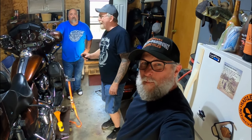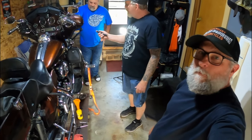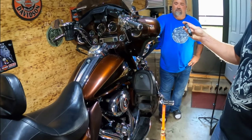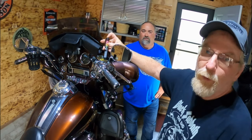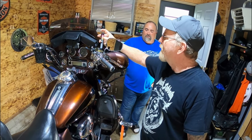Riverblood Baggers doing a little pre-maintenance to the motorcycles. Jerry's got us a brake fluid tester - just tests the moisture levels. You can see it's over 4%, so it does have water in the brake fluid.